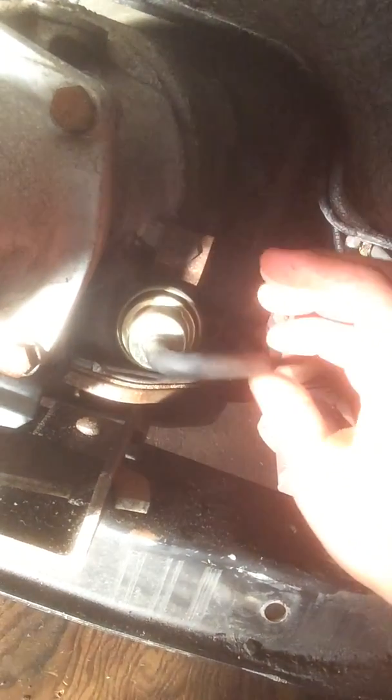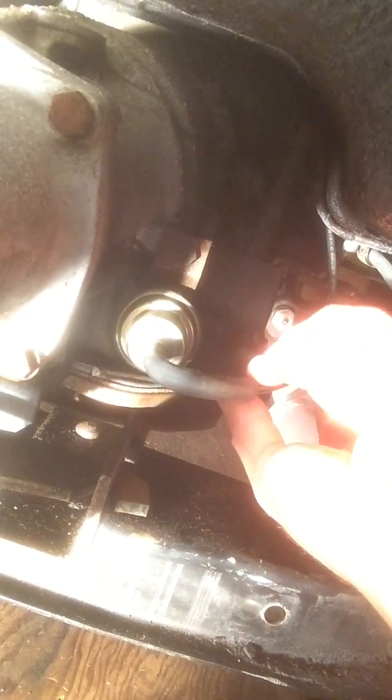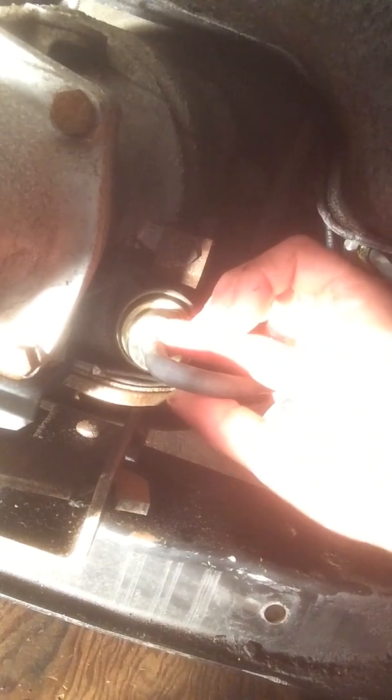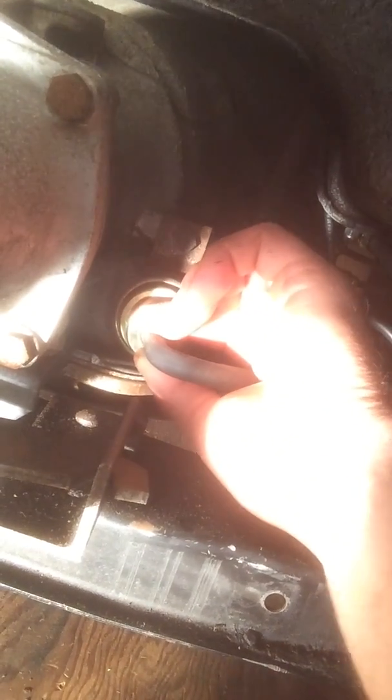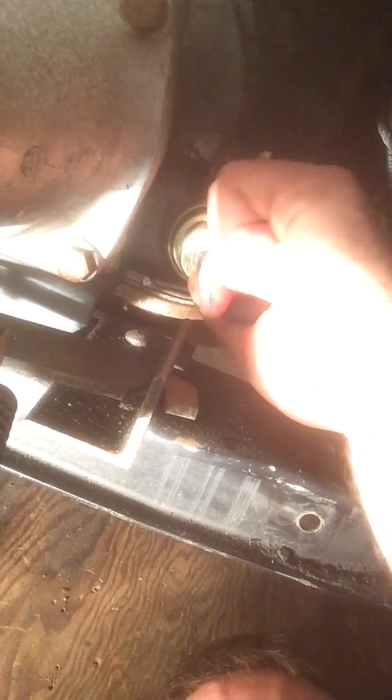That there is the guy we're talking about tonight — that is the vacuum modulator right here, this little gold guy. This is referencing off your manifold vacuum. What your manifold vacuum is doing is opening up this modulator valve, allowing your shift valve inside there to control your line pressure. Line pressure is how hard your clutches are going to engage. This happens to be an adjustable modulator.